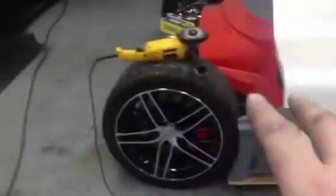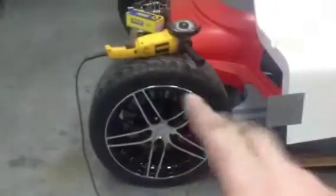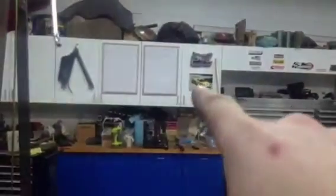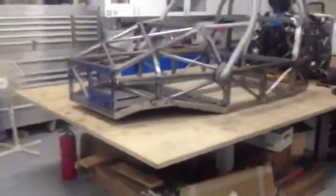It'll be a single-piece forging with a nice chrome 3-inch lip. The current wheels don't have much dish — they're a more modern style with a higher ET, which pushes the wheel further in and brings the kingpin further out. That results in a much lower scrub radius, lower steering effort, and lower jacking. The wheel pivots more around its centre rather than moving the wheelbase left and right when steering. This car will have a 40mm scrub radius, compared to some older cars like the Ultima which had scrub radius in the 5-inch range — so 40mm is still nothing.